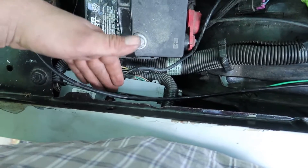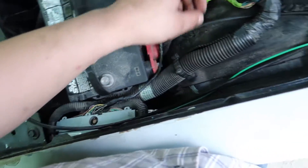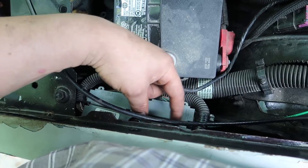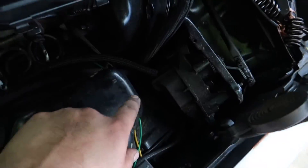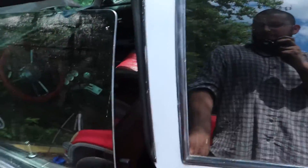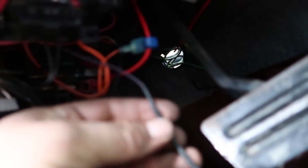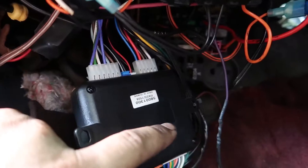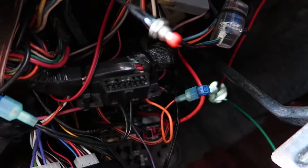I just got back from tucking in the computer — it's sitting in the fender. Ran this green wire to the green wire on pin 58 on connector 2, which is the one with the blue plastic caps. I ran it through under the booster, following some other wires that are already there, and went through the firewall. This is basically the only wire that comes from the engine bay. I soldered it right here and it goes to the back of the OBD plug that I zip tied to this harness.